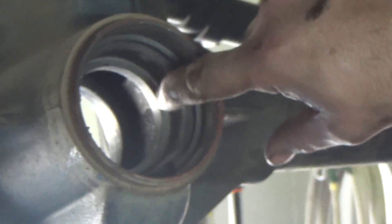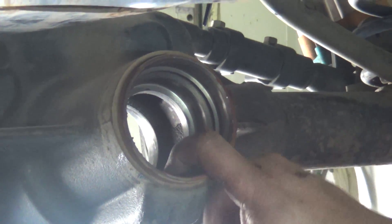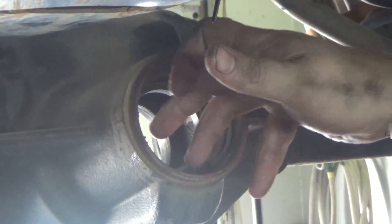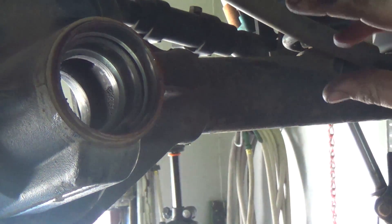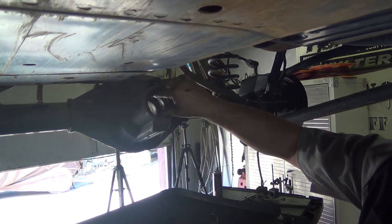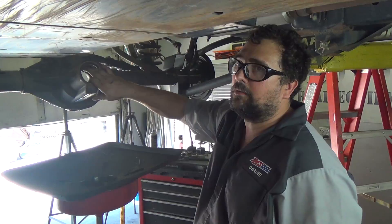This shoulder right here is where the front pinion bearing race was — we've already pounded that out and we've pounded the inner race out. Before we put the new races back in we're really going to make sure there are no burrs, no grit from cleaning out the old oil, absolutely nothing in the way that's going to prevent the new race from going all the way to the back. Where these live is part of the pinion preload tension and also part of the pinion depth, so if that changes later it can be a problem.